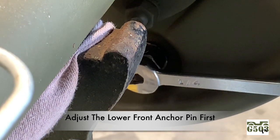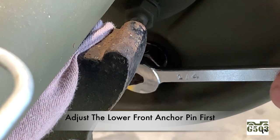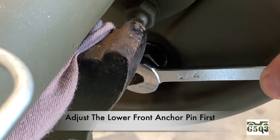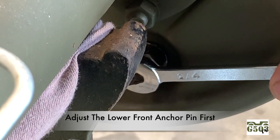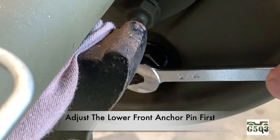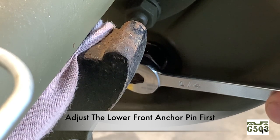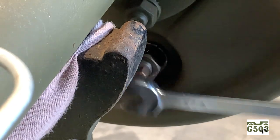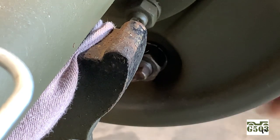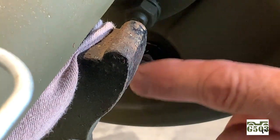And I'm gonna bring up on this. There's our drag right there. You can hear it. And then I'm gonna, from the front side, put that feeler gauge in that slot. I'm going to adjust it back to 5/1000ths. You can't see me up here in the front, but we're doing the same thing we did at the top two. Just gonna back off a little bit, check on my feeler gauge. And that feels about right. Let's see if it spins freely. Feels like we're good. So I'm gonna go ahead and tighten that up now.